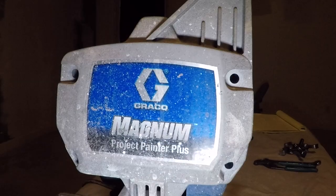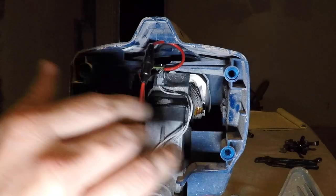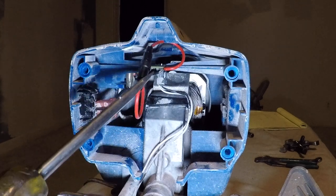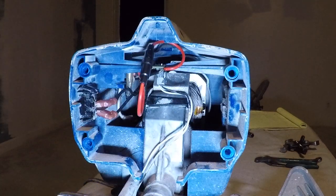When we started off and saw all those parts on the table it looked a little intimidating, but let's just pretend that you took off these four screws on the front cover — this is what you would see. The only difference I've made is replacing that fuse with an inline replaceable fuse. Other than that, I replaced the bearing that was inside here on the head and cleaned it out a little bit. As far as I can tell, that was the only thing wrong with it. So let's plug it in and see if it works.